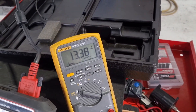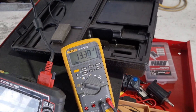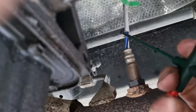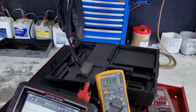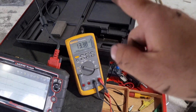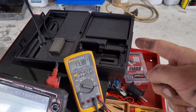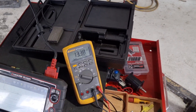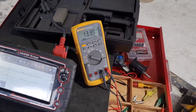So we're just looking at our heater circuit, making sure that's okay. We've got 13 volts on one wire — we just tapped into the black one. And then if we go into the other black one, again 13 volts. So essentially that's saying that the heater is not being commanded on. We've got voltage coming down, going through the heater coil, and then back up, but it's not being grounded and controlled at the moment. That's why the voltage is the same on both sides — otherwise you'd expect the voltage to be used on the other side. So we can say that's probably okay.